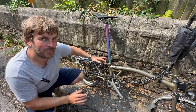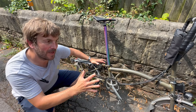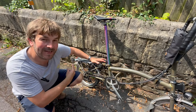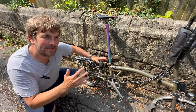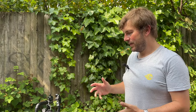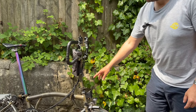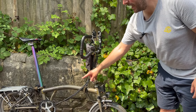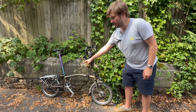There are also some maybe suspect purchases. What I'm going to do now is start at the front of the bike, go to the back, and point out little bits you should look out for when buying a second-hand Brompton. With any bike, not necessarily specific to Bromptons, you always want to have a look at play in the bearing or pivot points. The main ones are wheel hubs, headsets — that's generic on any bike — and bottom bracket. And specific to the Brompton are the hinges and the rear pivot.